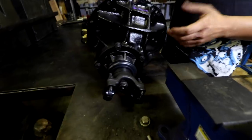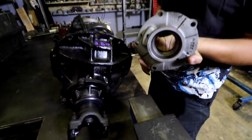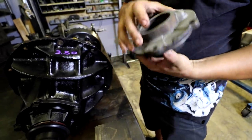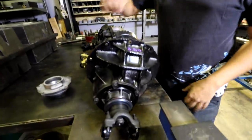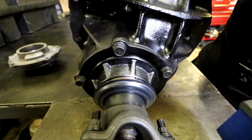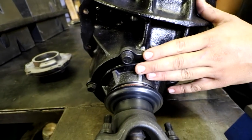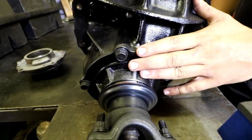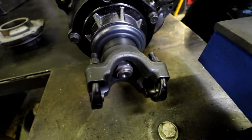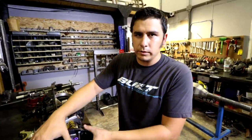Okay, makes sense. A couple things that you typically don't reuse is the factory pinion support. This is what holds the pinion into the housing. And the factory one has pretty small bearings and a pretty narrow spread. So the common one for a mild-ish build would be the Daytona support. That adds a little bit more spread between the two tapered bearings, and it increases the inside bearing significantly. That's a common upgrade. It's not very expensive, and if you're going to go through it, it's one thing to change. Highly recommended. And then also the yoke. It's not very expensive to go to a 1350 forged yoke, which is the U-joint size, and that keeps this thing as strong as you can make the factory style third member.